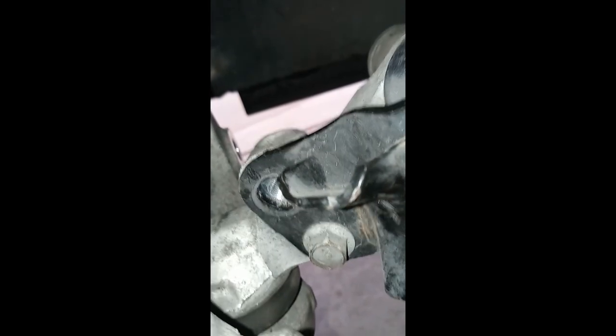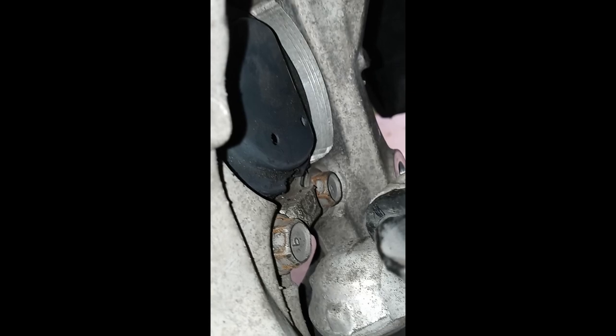We're still working on getting this wheel hub off the Infiniti. You see this one bolt that's missing? That bolt holds a bracket that holds the strut onto the control arm — I had to get that bolt out of there to access the two bottom hub bolts. We have both bottom bolts loose. I had to use the 3/8ths ratchet with a 17mm and an extender, plus a flex socket that bends so I could get up inside there. I used an extender bar for leverage and broke it free without stripping it. So far we've got two of the bolts. We're going to try to get the other two at the top.